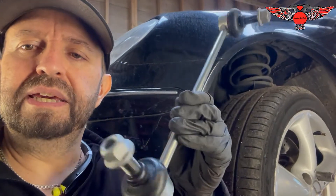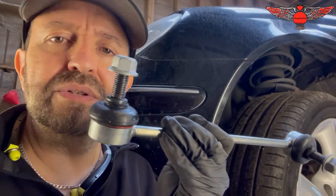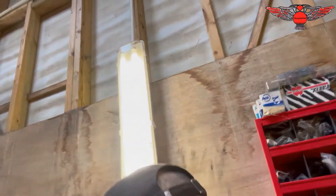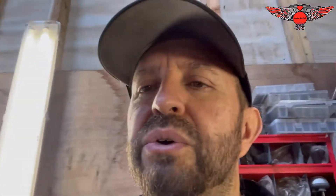The part I'm talking about is this anti-roll bar link here, and we're going to need an 18mm to get these nuts out, and also we might need a T40 Torx for the center of where the nut is. Just wanted to show you how to check your anti-roll bar links — sometimes they're noisy, sometimes they knock. In this case I'm changing it because the rubber around this joint is broken. They're not actually knocking, they're okay, but this car has been sold recently so it's better if it goes out with new anti-roll bar links.